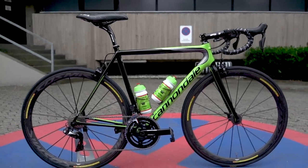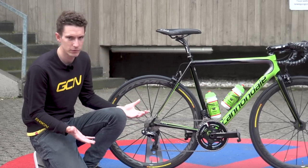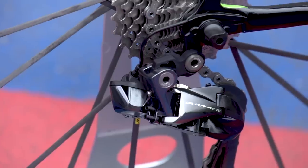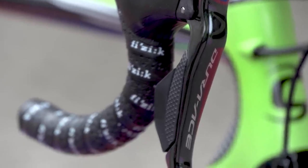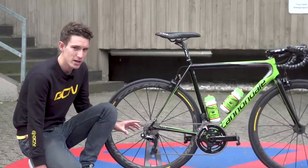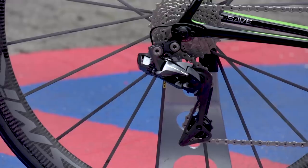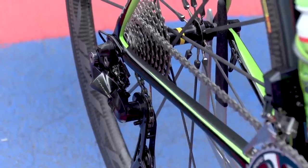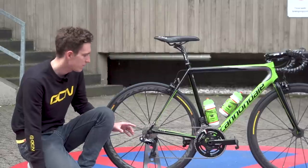As well as getting new frames, the riders are also getting new Dura-Ace. Now I say the term new Dura-Ace quite loosely, because it was technically released over a year ago — but we've not seen much of it on race bikes until now. So this is the new 9150 Dura-Ace Di2. Particularly, the rear derailleur has a really useful touch, mainly for the mechanics. It's got a slightly longer cage on it, so that means they'll be able to use 11 to 30 tooth cassettes without swapping the rear derailleur, whereas they used to have to swap it out for an Ultegra Di2 rear derailleur.